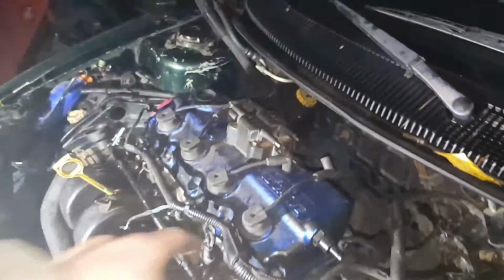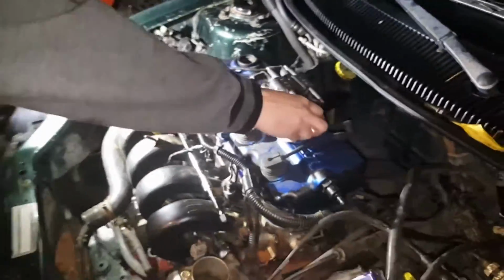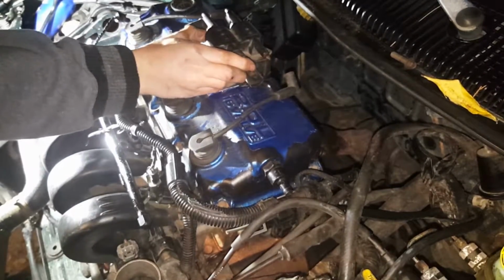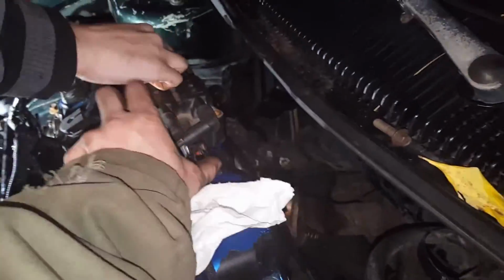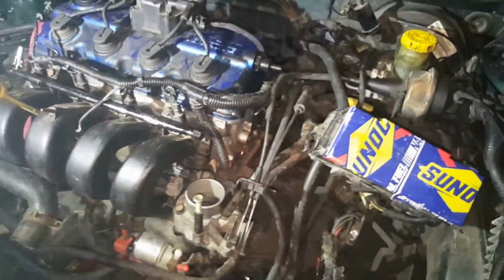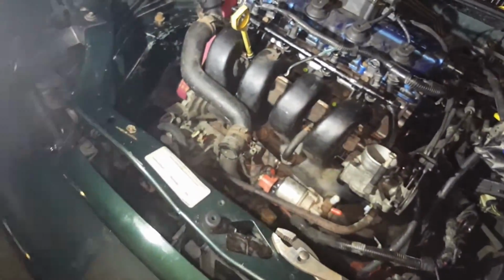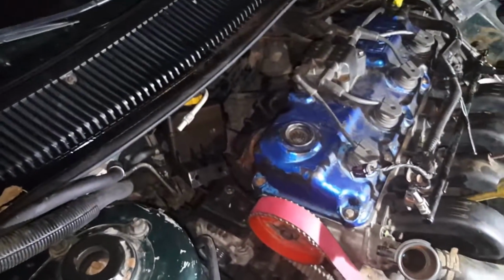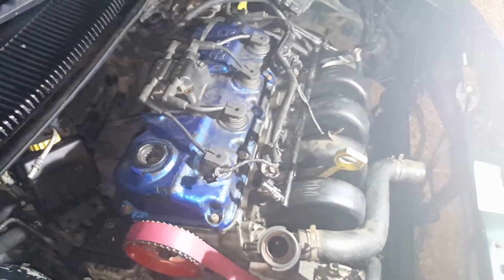We almost got our time to fire up. Oh, you can plug these in. They go in the order basically right where they're at. Until you hear it click. Bam. Alright, after we get that hooked up, we'll plug this in. We got the map hooked up, we got the injectors hooked up, we gotta extend our coolant temp over here, hook a coolant line in. We got the timing hooked up. About ready to fire up and listen to it run. So, yeah, we'll try to finish this up real quick, and then we'll be back.